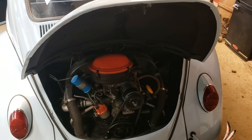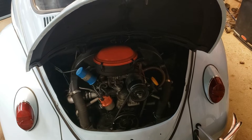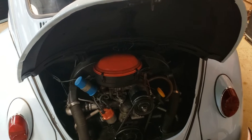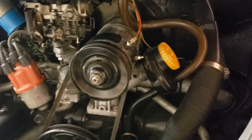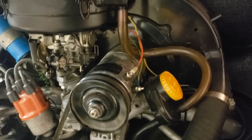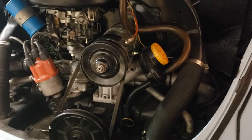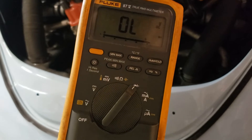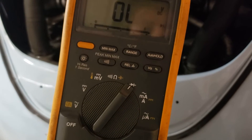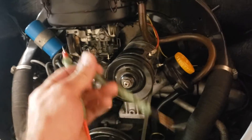The first thing I did was double check that I didn't have any direct shorts — meaning no positive-carrying wires shorted to ground, as if they were stripped or the generator was shorted. I unhooked both wires from the generator and made sure they were just up in the air, not laying on metal. I put a clip from my voltmeter on the continuity scale. You can use ohms, or if your voltmeter has a diode setting like mine, that gives you a beep, so you don't need to watch the meter — just listen for an audible beep.